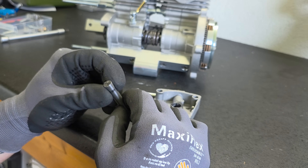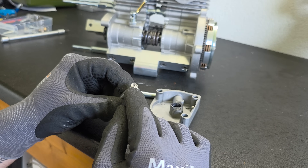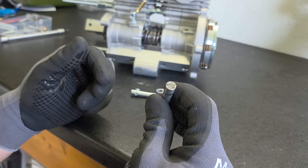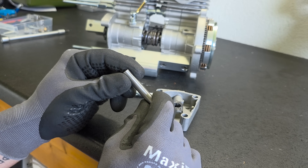This is the reason why my clutch got very loose. You can see the clutch lever is really digging into the material. I have to say this is not hardened steel — it's just steel that was lying around in my workshop that I machined down to the diameter I needed.